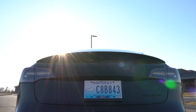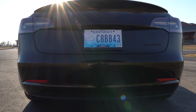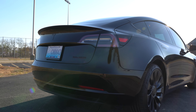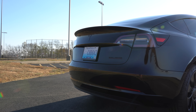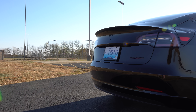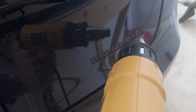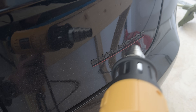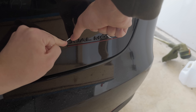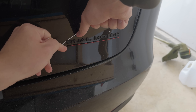If you have a dual motor badge, you can still Plasti Dip and it will come out all right, but I would just recommend replacing it. I'll have a kit linked below where all the lettering is in an alignment tool, so you can just put the whole thing up to the car and stick it — no placing it letter by letter. If you're planning to remove your badges but don't know how, just grab a heat gun and some fishing line. If you don't have that, try a hairdryer and some dental floss — that's what I used, and while I went through almost an entire thing of floss, it worked.